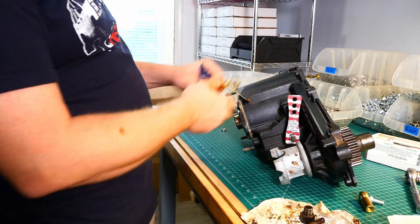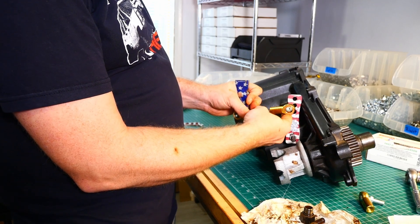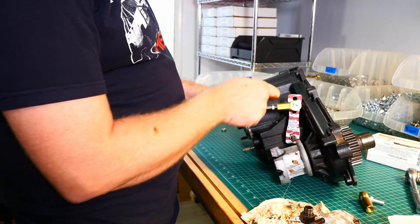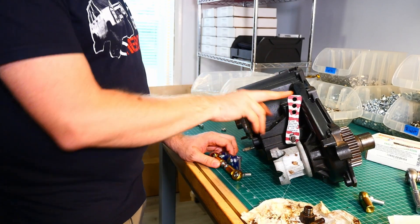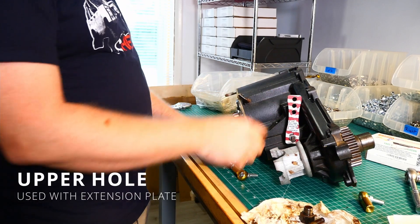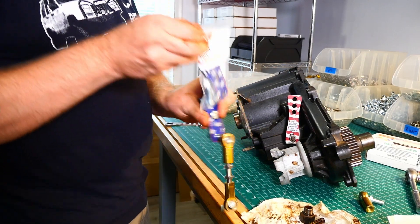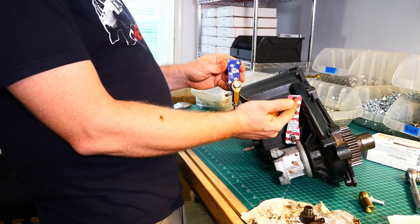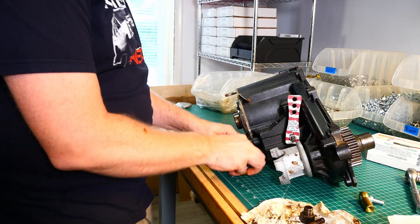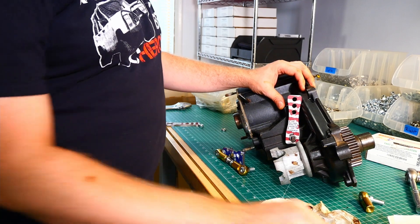So I have this, and I have it in the gear I want. I have this in the gear I want. I'm going to come down here and rotate this until my rod end is positioned to perfectly go in that center hole. The center hole is what we want to use for most 231 installs. We recommend the upper hole for whenever you use one of our upper linkage plates — you get these with our 242 kit, so you'll get a second one of these. They chain together, so they stack. Whenever you drop this side of the lever, we want to bring this side up, so we're going to use that top hole. The bottom hole can be used for custom installations, but for most of what we need, we're going to go with that center hole right there on the lower linkage plate.